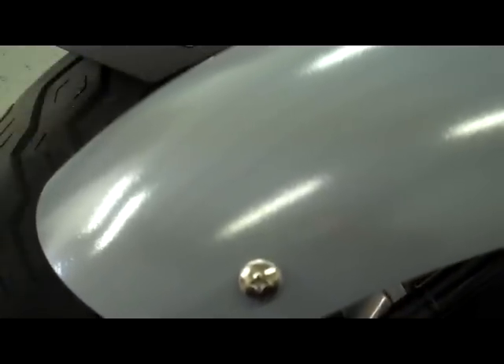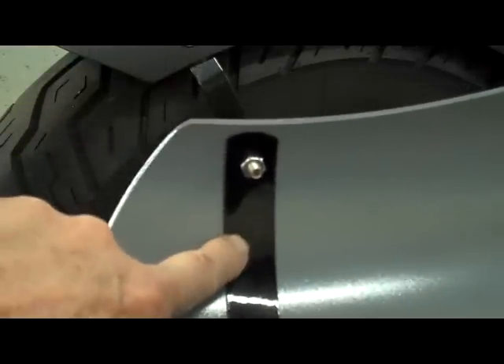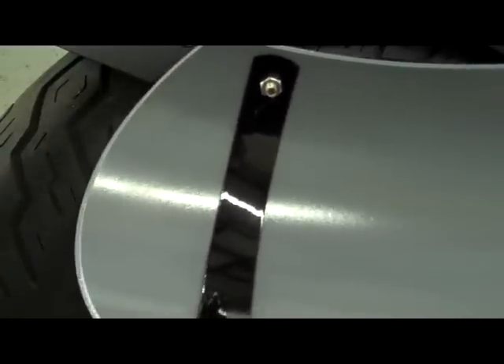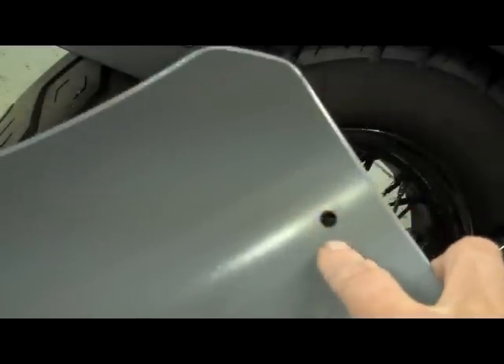This is our new aluminum fender that you received in your kit. You'll notice it has a gray powder coat primer on it — it's kind of pebbly. All you have to do is sand that smooth with wet-or-dry fine sandpaper, 320 to 500 grit, until it's smooth and all those little bumps are gone, and then it should be ready to paint. If you've got the bare metal one, you'll need to handle that accordingly. We still recommend using the reinforcement straps — go ahead and silicone those in just like the video shows on the fiberglass fender. We supply the nut in the kit; use the mounting bolt in the strut to hold it, put silicone in, and let it dry overnight. This bonds the strap to the fender and makes it stronger, and if you ever take the fender off the strut, the strap will stay in place. Do the same thing on the front — drill holes and silicone everything just like we show on the fiberglass one.